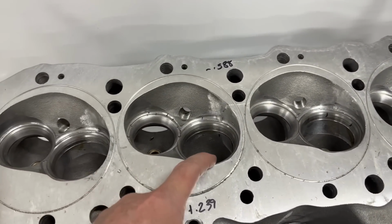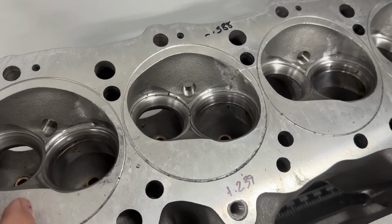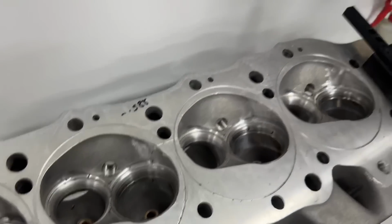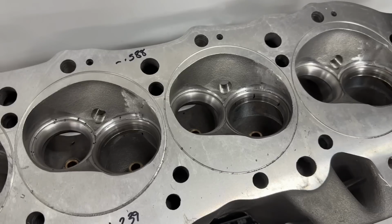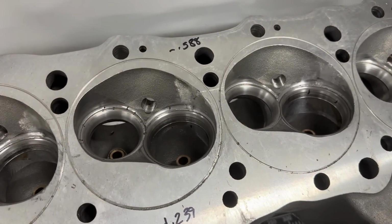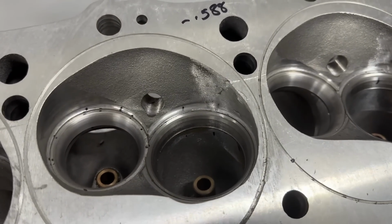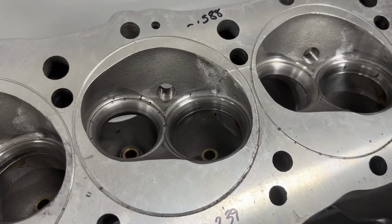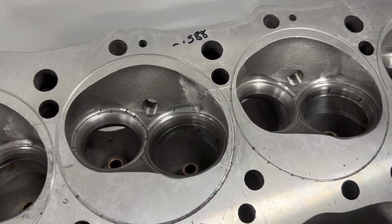And then you've got this piece of crap I hate. This is Stellite. Stellite's probably one of the hardest seat materials ever. I have brand new blades sharpened to the nth degree, and my Rottler has done fantastic on almost everything it's touched until this. It'll cut, and then it starts chattering around, because the seat's just too damn hard, especially for my blades. You see how mine's taking out all this angle? If you just had a little cutter with three angles, you probably wouldn't have that big a deal. But I'm taking out all this material, and I had to cut to a larger area. With this Stellite, oh my gosh, it's hard. For one, it makes everything get hot, and you're like, well, that's good. It isn't sharp enough. I can't make it sharp enough.